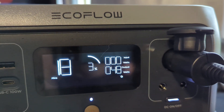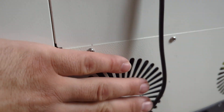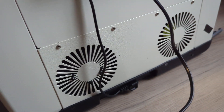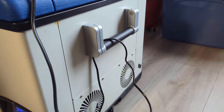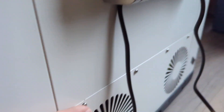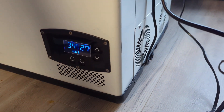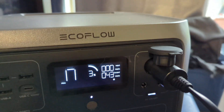I've been running it on eco mode, and I also installed a second fan here for extra ventilation of the machine compartment — it was running a little bit hot before. I think the increase in work hours can be credited to this extra fan, because much more cooling is going on and the condenser cools much better. That extra fan only draws another 3 watts, so it's a very good addition.